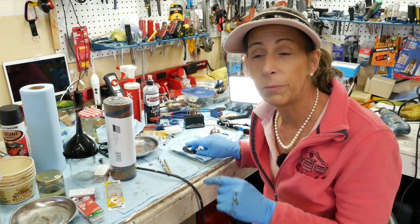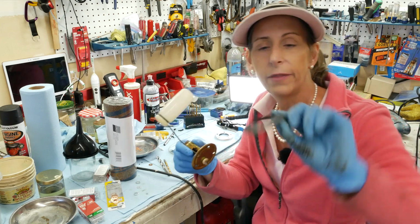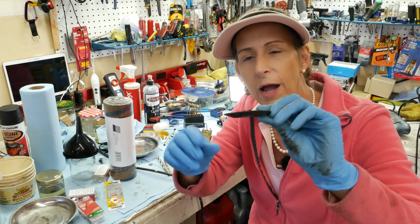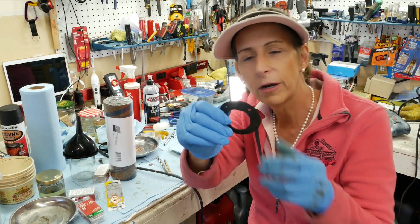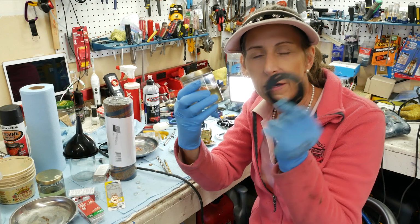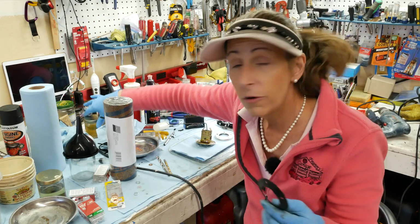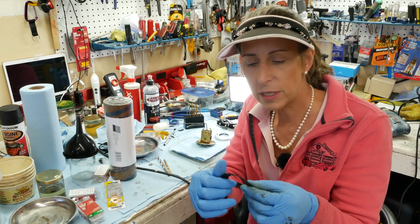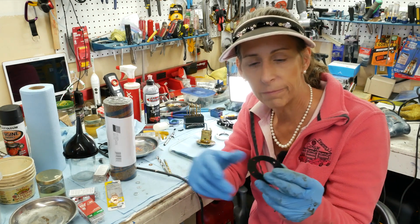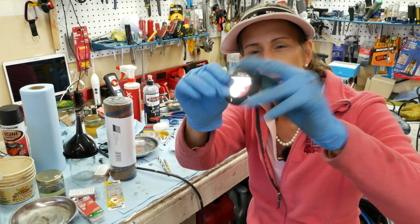And you remember yesterday we put in a new gasket on the gas tank for the gas sender here, for this guy here. And this was the gasket I made. This is made out of neoprene, and I thought that neoprene would work pretty well for gasoline, and it's not really falling apart. But since I wasn't super certain, I took a vat of gasoline and dropped a few of the bits of this into it overnight, because I just wanted to see, is it gonna dissolve, get slimy, anything like that. And you know what I found, which was kind of weird, was that it wasn't slimy, and this one isn't either, and it held together pretty well, but if you pulled on it at all, it would just snap and fall apart. And then when I pulled this guy off, you see how it must have expanded a bit. Take a look at that. I think it just kind of domed out on me there.